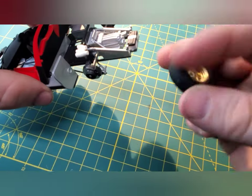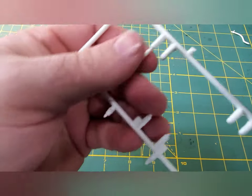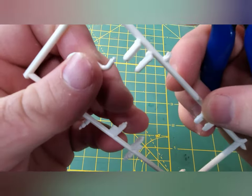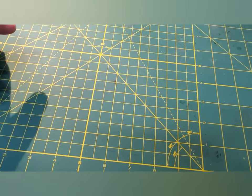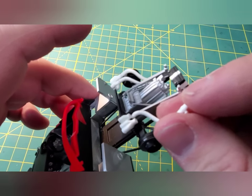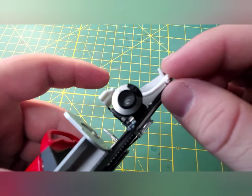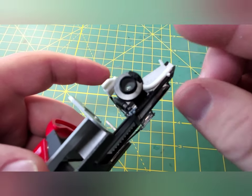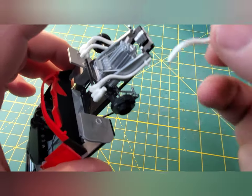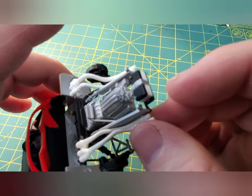One last bit — this is the last of it that had to get cut — was just me putting in those frame rail thingies that hold up the spare tire. When you cut these off, leave the nubbins a little bit long because that is what locates inside the exhaust collectors. On this very last one I had to cut it real short because the hole in there wasn't very deep and it wasn't allowing me to line it up on the bottom. For me right now it's easier just to cut it short than trying to drill it out to the proper depth.